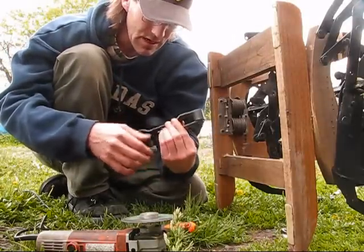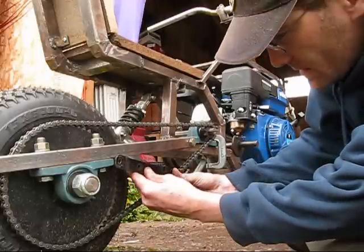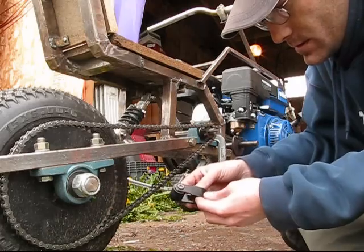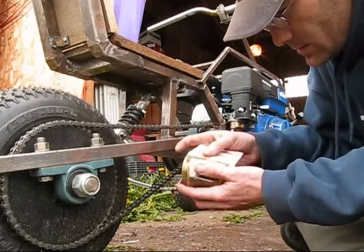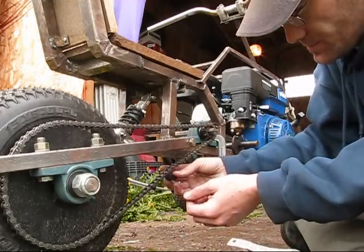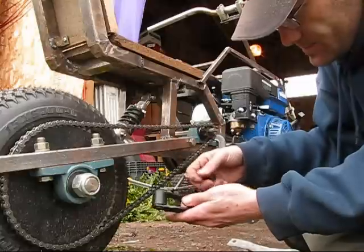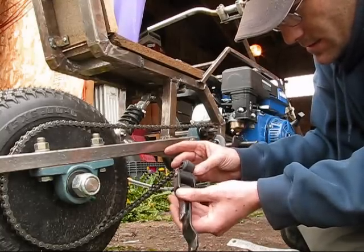Alright, that's what I was after. So I just took that thing off and it looks like I'll have to put it in like this. But the thing is, this is hard plastic, and that'll make some racket while the chain's rubbing against it rotating and stuff. So what I think I'm going to do is grind out this pin, take that out, and use these. These are little rubber insert grommet type of things that go into a shock absorber — so they're rubber. Rubber won't make all that racket. So I'll put that in there with a bolt going through it, and I'll probably need some washers to make sure it stays centered so it's not riding back and forth on the bolt, because that'll make the chain wobble. I don't want that.